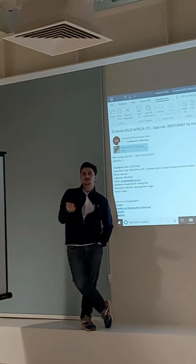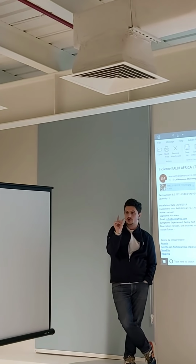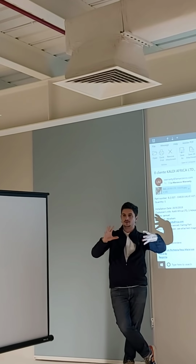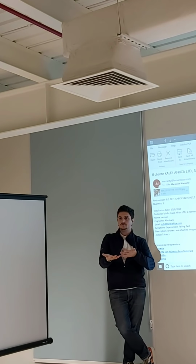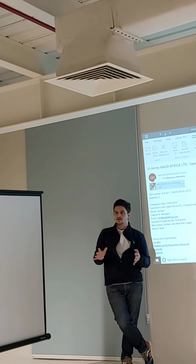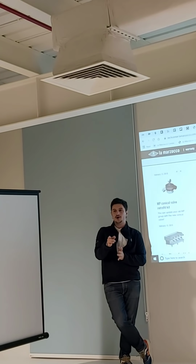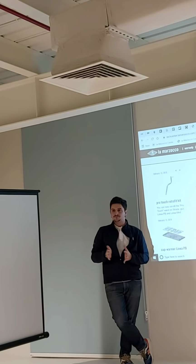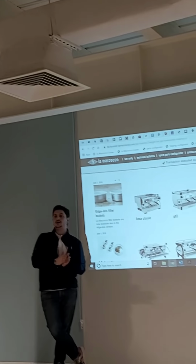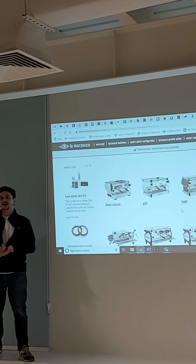Most of the time, for example, it happened with scales. On the ABR, some people might experience some problem just with the load cell, and on the warranty claim, they put the whole ABR cell. You don't need to do that. It's not because we don't want to send it to you, it's just because you need to open the cell. Just change the load cell and you'll be fine. So we reject it, saying that is broken. You don't need to change the plastic cover. The plastic cover is fine. Or sometimes they read wrong on the catalog. That can happen, that they read the part number from another model, and that's not the same because they're not compatible. And most of the time, it's for that.